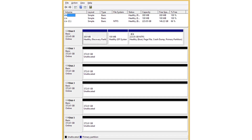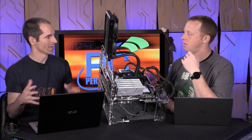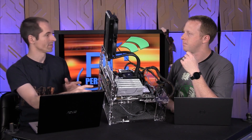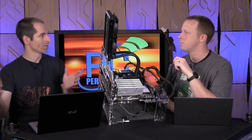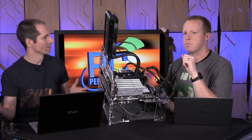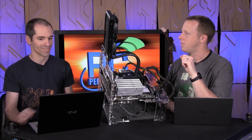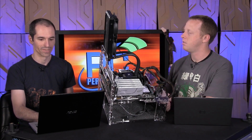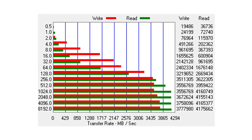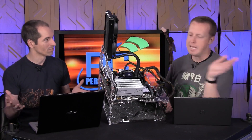I configured the array and set it up for striping, and everything looked good. But when you run a simple test like Atto, which uses a relatively small test file, I looked over and the access lights for only two of the SSDs were lighting up, because the file was only overlapping what Storage Spaces allocated to a couple of them. So you're not getting striped performance from all drives simultaneously. The Windows software RAID was a little bit better, but Atto still capped out just a little over 4 gigabytes per second.